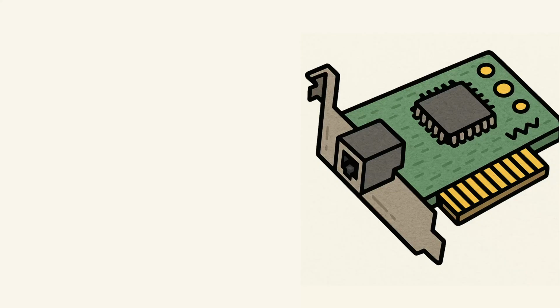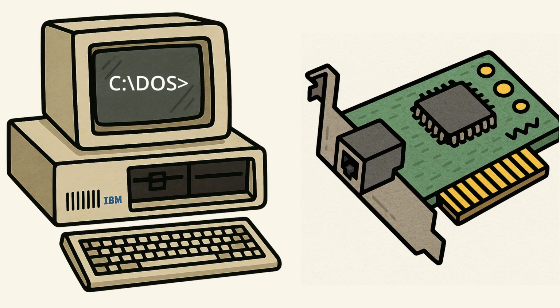Second problem you have with DOS applications anyway is that they require what's called a packet driver. The packet driver is the way that the network interface card is interfaced in DOS. So rather than write directly to the network card, you write data, receive and transmit and all that good stuff to the packet driver. The packet driver intercepts that traffic and then sends it down to the network card on its merry way to the internet or wherever it's going. All right, simple so far? Cool. If you have one application and it's just going, right, talk to the packet driver, talk, no problem.